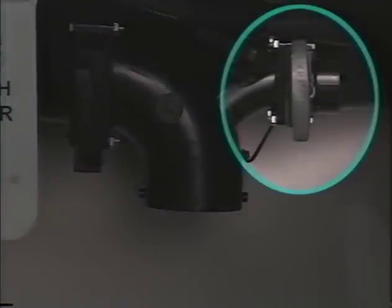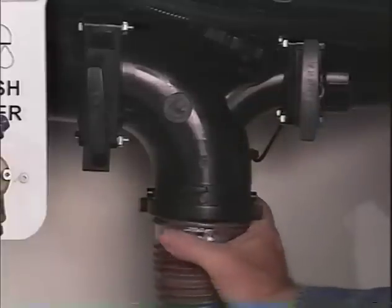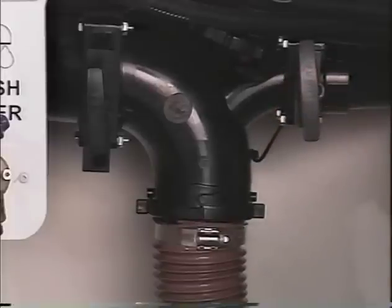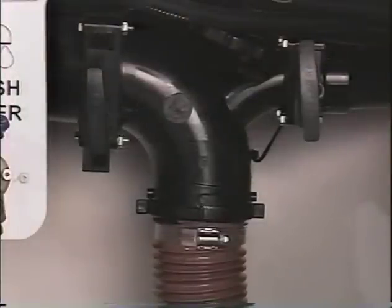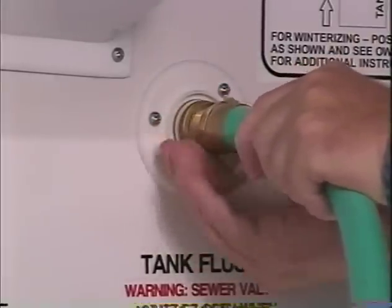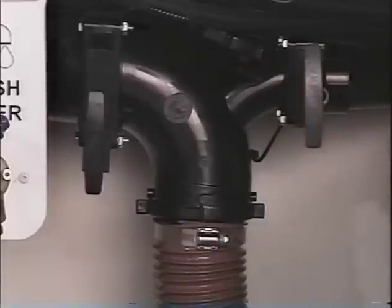The black tank drain valve is for discharging solid wastes. The gray tank drain valve is for other liquid drainage such as sink and shower water. Check the hose clamp to be sure it's connected securely. With the sewer hose properly connected, open the gray tank drain valve to allow the system to drain. At some point before emptying the entire system, close the valve in order to have at least half a tank with which to rinse the system. To fill the gray water tank, run water in the shower or sinks and use the monitor panel to observe tank fluid levels — when the gray tank is half full, stop filling it. Keep the black tank drain valve closed until you're ready to empty the tanks. When that tank is empty, attach a non-potable hose to the flush system fitting and turn on the water supply. Let it run for at least three minutes, then open the gray water valve to rinse the lines, and close all the valves.